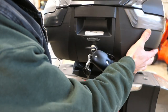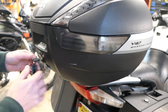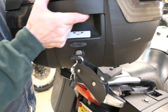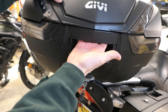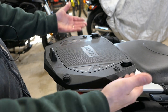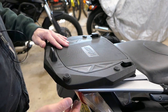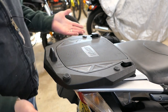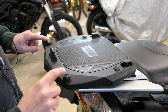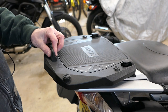To put the box back on it's just a matter of sliding it on and pushing down — you're done. Let me show you what it looks like when you have the box off. The box slides off and it does have a handle right here so you can hold it and take it with you. This plate is what you're left with, and this is something you need to buy that fits on your bike. It basically sandwiches on top of the BMW flat area, and it's a pretty clean look. With the top box gone you could mount soft luggage or other stuff on here without any problem. There are some rubber bumpers which keep it from rattling, and the case fits into these little mounts and then locks in the back.